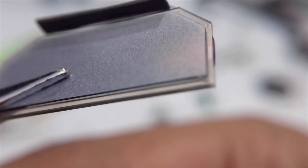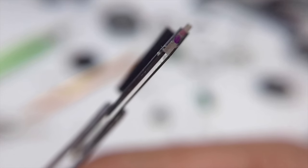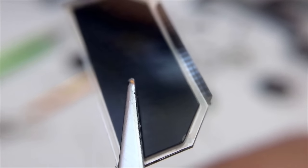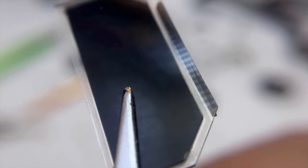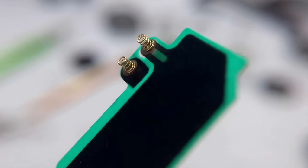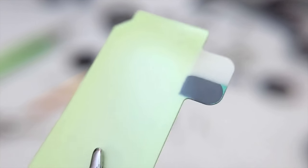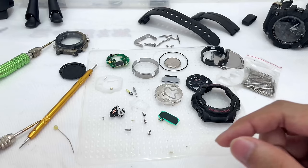This is the display panel of your watch. If you have a negative display you could take this polarizer out and put a new positive display version in — problem solved. If you want to add some logos or signatures at the back to make the watch more collectible, you could do that as well. And this is the electroluminescence sheet — it glows green, connected with those two springs, and that's the EL backlight that lights up the digital display on your G-Shock watch.